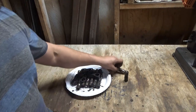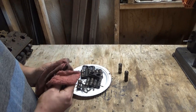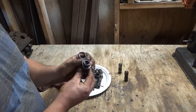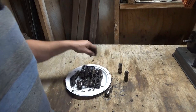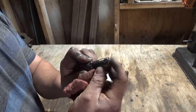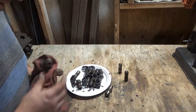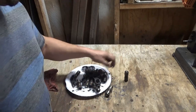I'm trying to build this engine as cheap as possible. But seriously, about any of this — if you're in doubt, just put new stuff in it and spend the money. That never hurts, except for your wallet. I've already looked at all the lifter retainer trays that hold the lifters in line — everything looks fine, that stuff usually is fine. But now I'm going through and making sure all of them spin silky smooth. That rust right there is not that bad — it would probably be fine — but I know a lot of people who would just put it in anyway. Not me though.